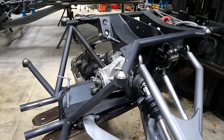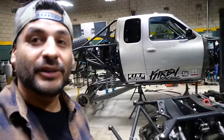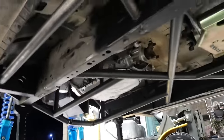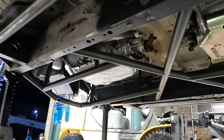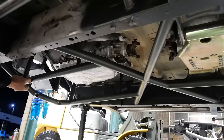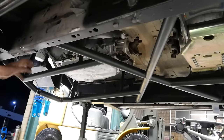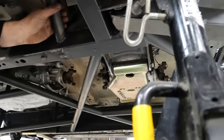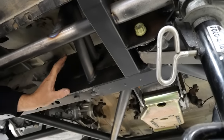You've got to check out the underneath. There it is — I kept the frame, which gives me like an extra 10 inches of room. Lots of room now, but once I put a drive shaft going all the way to the front, that's going to take up space with the exhaust. By having the frame rail I was able to build off it — this was all existing cage that was already here. I tied it in and made these all part of the cage.